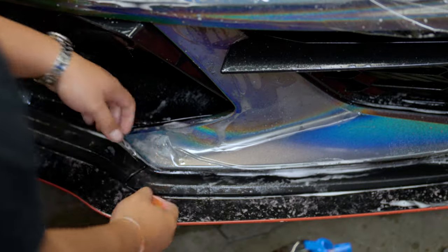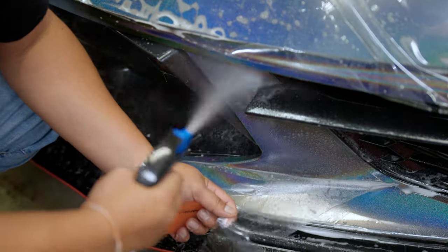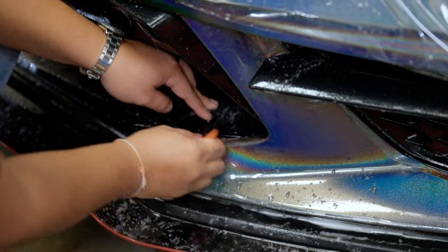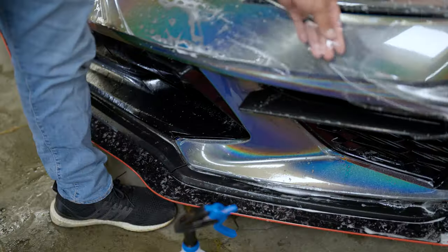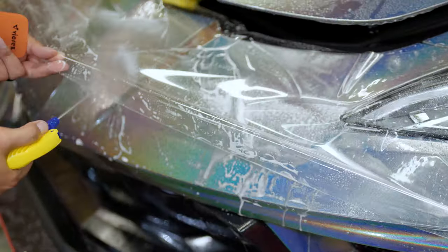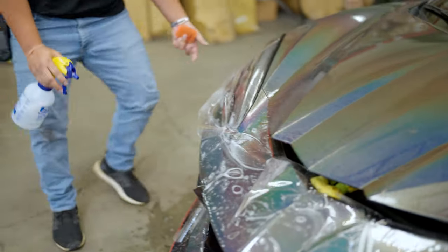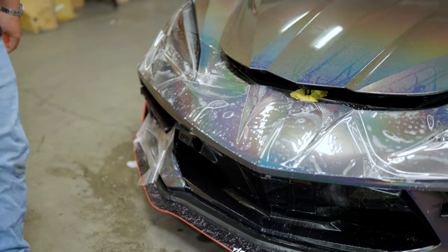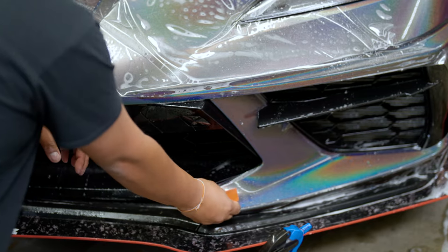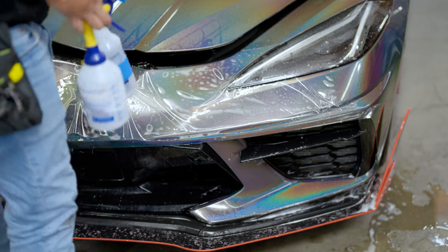So now we're going to peel this part back since we've got the bottom lined up. Spray our tack and start squeegeeing, overlapping our strokes, just going to work our way back up for our adhesive to set. We're going to spray some slip solution under our film. Now remember, you want to spray everything but the corners that are holding your film in place so we don't run that risk of it falling on the floor. Going to spray our corner, hold it down, squeegee, hold it down. Now we're going to work with our top part.